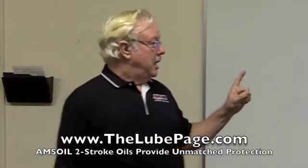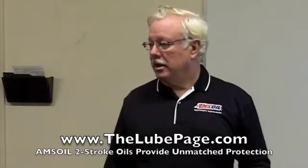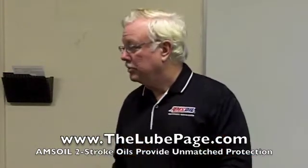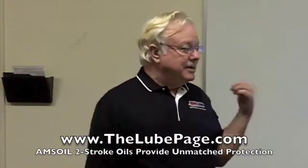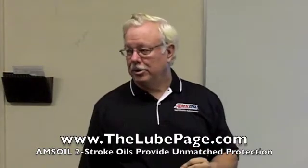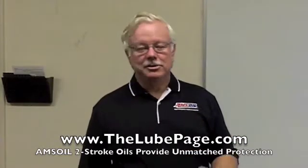Okay, now, in these oils, to begin with, these two-stroke oils from AMSOIL are almost universally ester-based products. So just the oil itself is a tremendous lubricant because esters are sometimes used as additives in oil to improve the lubrication quality of oil. So by the fact that the base of the oil is primarily ester, I'm already starting out with a superior lubricant. And then, instead of putting metallic anti-wear, anti-scuffing additives in it, what we do is we put polymers. Polymers, that's right. Pieces of plastic. Space-age polymers.